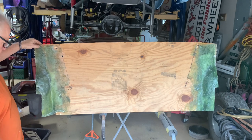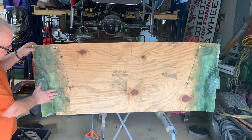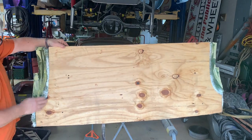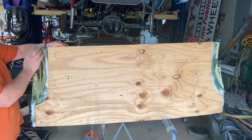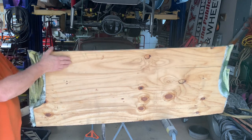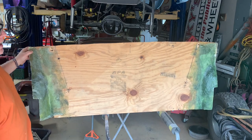Maybe this makes a little bit more sense now. I've got all the stuff that we're not going to use cut off of it. You can see some spots that I've still got to go back and put a little bit of glass, but all this side right here will get sanded again, and then we'll do the back side to hook this glass to the back of the panel. This will all be smooth, and then our upholstery will be able to wrap around and glue to the fiberglass on the edges, just like it would if it was made out of aluminum. Being glass, it's going to allow us to trim as we need to.